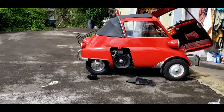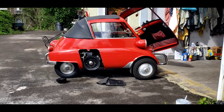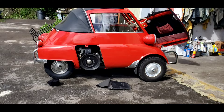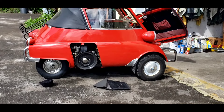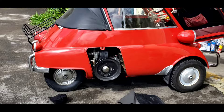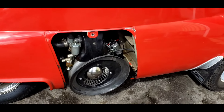And the Isetta — oh boy, how did I get involved with this? This was a crazy deal. The guy brought it in, said there was a big bang, the muffler fell off, and one of the Guibos broke. Replaced the Guibos and started to replace the muffler, and then I grabbed the exhaust and the whole top of the engine is loose.